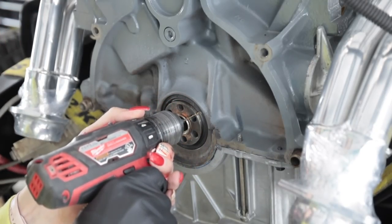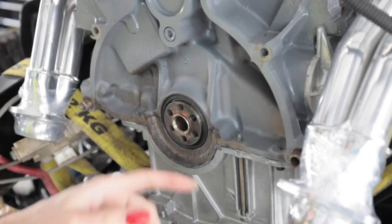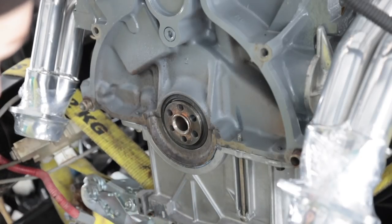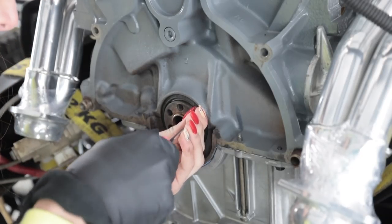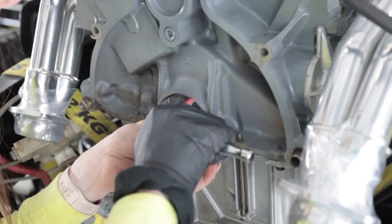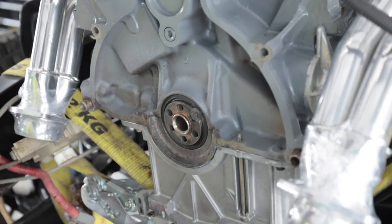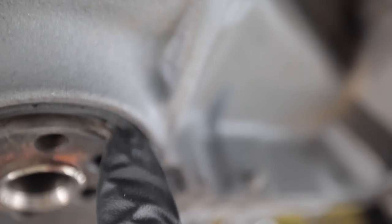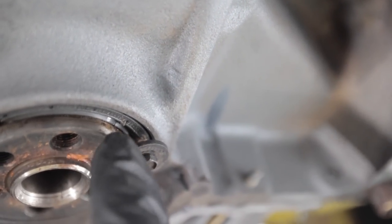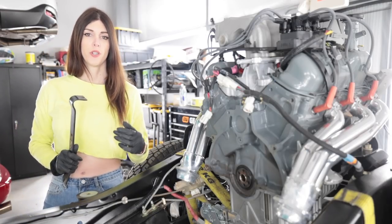And I'm through — I got into the metal part of the seal without hitting either the crank or the outer wall. I'm going to screw a screw in here. It's so much easier doing this on much larger diesel engines; it's tough on something this small. Make sure that screw goes in straight. I had to start the drill bit slightly upwards, just enough to bite into the inner metal core of the seal, and once it bit in I could straighten the drill bit so it went directly in without marring either surface. To do this successfully you just have to have good eye-hand coordination and patience.